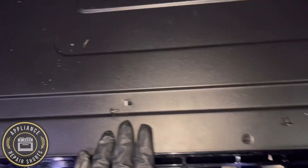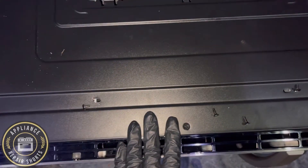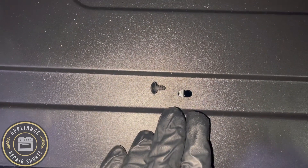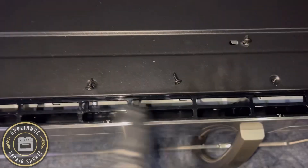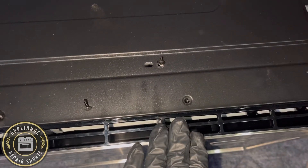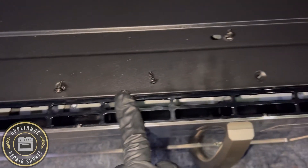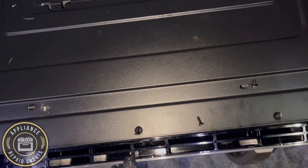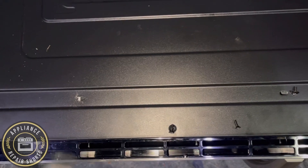Let's do that. So to keep your screws in order — sometimes you put this thing back together and you have screws from different places. Don't do that. Good practice: take pictures of the screws where they're at, or have a baggie. Put top screws in the bag. These are pretty easy to remember — they have the flat head — but I like everything to be back exactly the way it was. So make sure they're organized and you know where they go. These are the top screws — pay attention to them. Organize them.